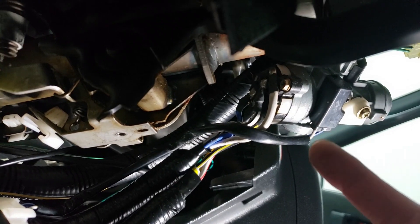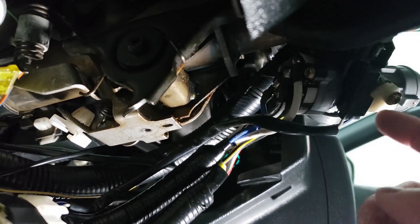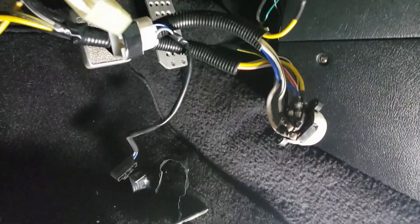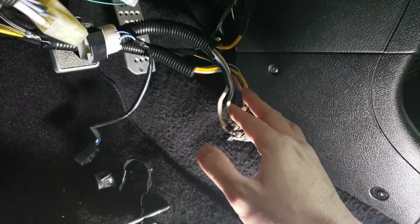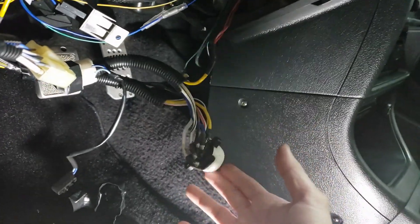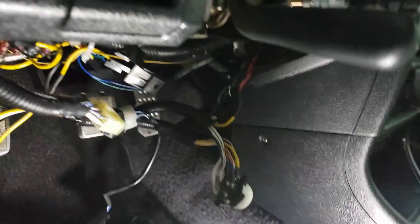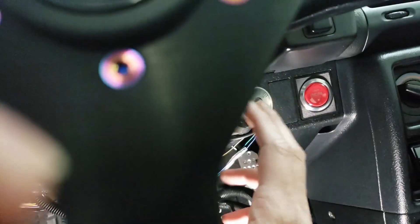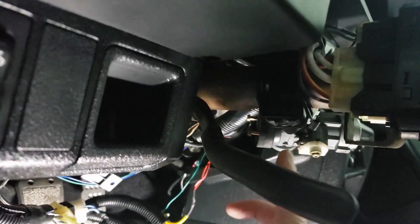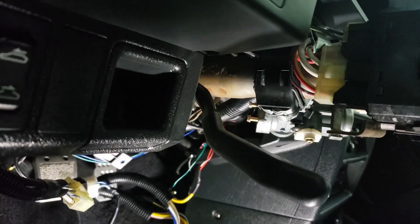Now the ignition is exposed. You can see the ignition switch — there's a screw on each side that you have to remove, plus a screw that removes this piece as well. Once those are out, the ignition harness comes out. If you plan on mounting your push-start button where the key lock cylinder is, you'll need to remove the tamper-proof cover and drill or chisel out the bolts for the steering lock — there are two, one on the bottom and one on top.